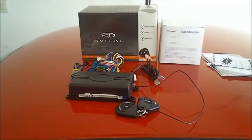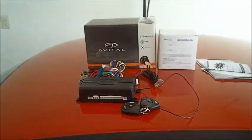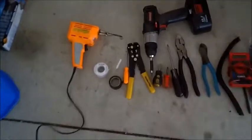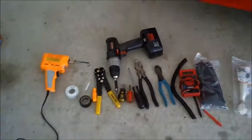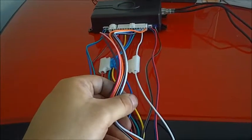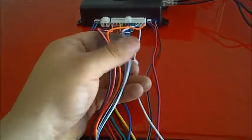The brains are usually the same as well, with slight differences, but overall this will apply to pretty much any Viper system you put into this particular car. The first thing I do when prepping these — you prep them outside of the car just so things end up neater once you're actually in the car. First thing I do is plug all my harnesses in and then go through and pick out the wires I'm not going to be using.